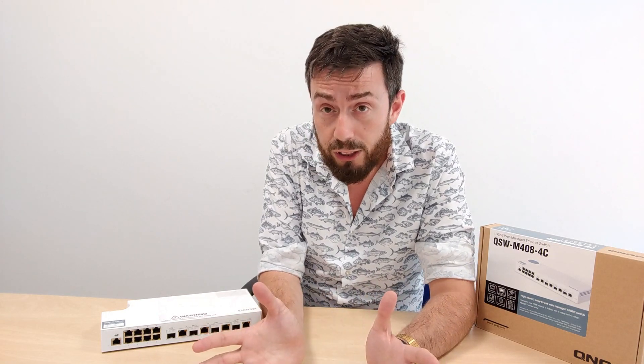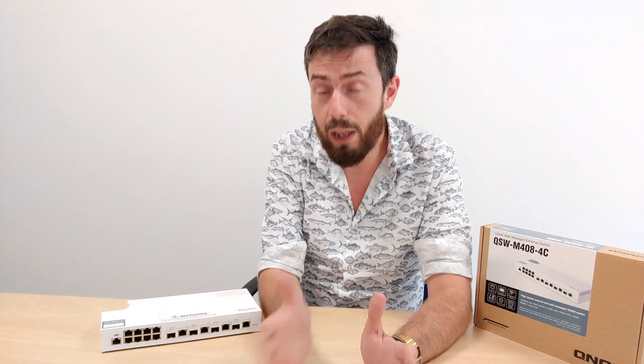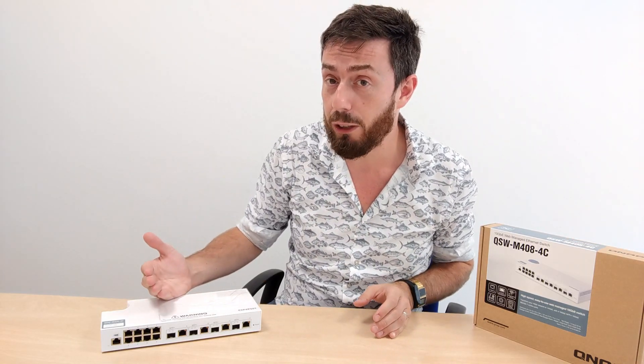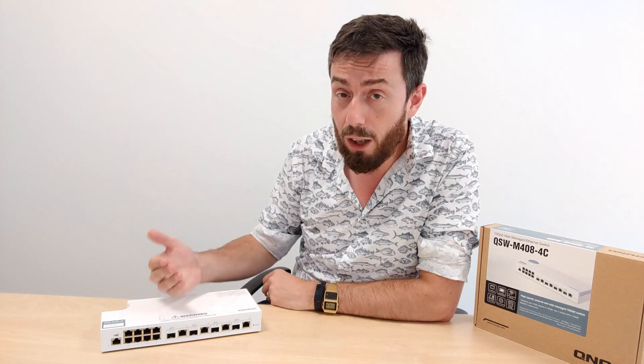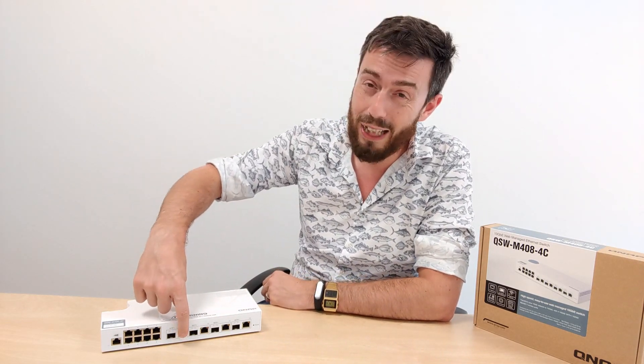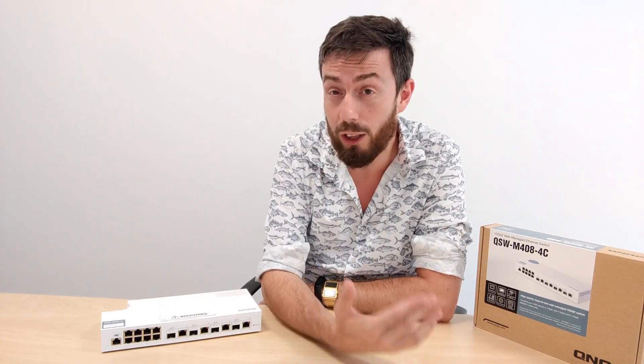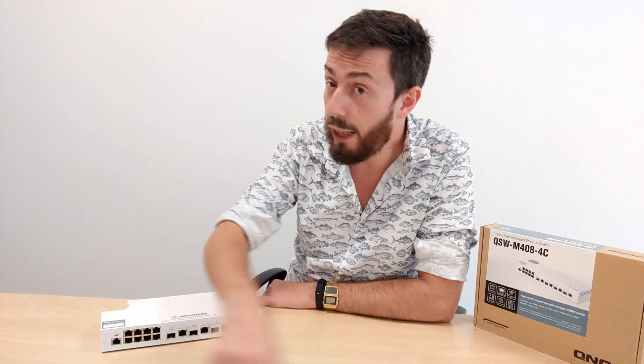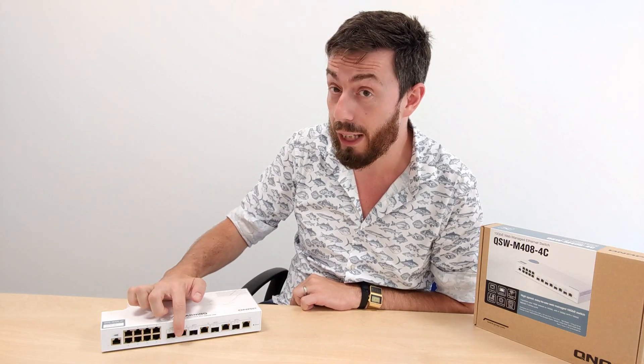There are obviously other advantages to a managed switch that utilizes both of these environments. SFP is generally considered a much wider, longer area network where you can use much longer fiber cabling and maintain those performance benchmarks, whereas copper or 10G Base-T in the case of 10GBE ports normally has around about 20 meters in it. Once you go over 20 meters you start to see degradation unless you go for quite high quality CAT 6 and CAT 7 cables. This allows you to create, via this one managed switch environment, a local 10GBE environment where people can edit photos and video in real time over the network on a NAS, as well as incorporating a fiber 10GBE network.